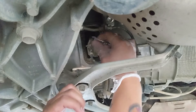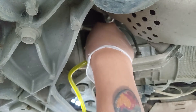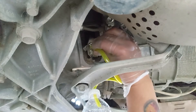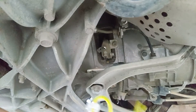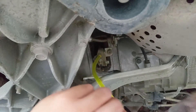I've never done this before so bear with me if I screw this up — we're gonna need a new CSC. Underneath the car, go to the transmission and find the bleeder nipple. After some struggling trying to get the hose connected — moments later, more moments later — eventually by sheer coincidence I got it. Okay, hold it... okay stop. It's not coming back — good.